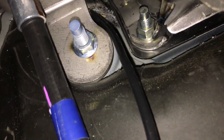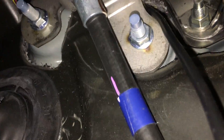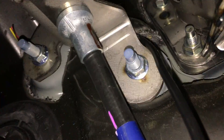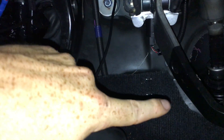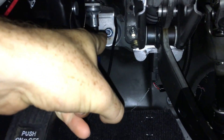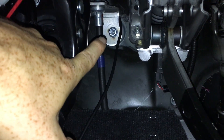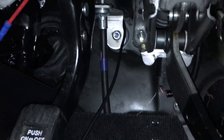Here's your parking brake right here. If you just follow it up right here, this is where one of my wires came down from. The other one kind of got caught up in there, but you just have to reach up there to feel for the loose wire. Looking back at it, you have your parking brake here, brake pedal is just right here, so right in the middle go up, and you see that screw right there basically on your firewall — it's up under that area right there.